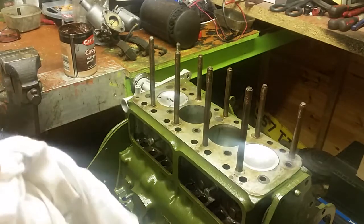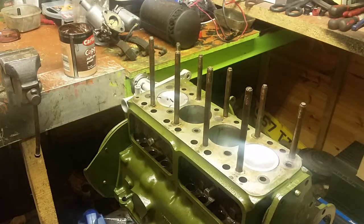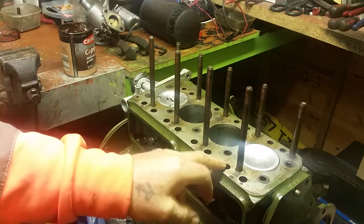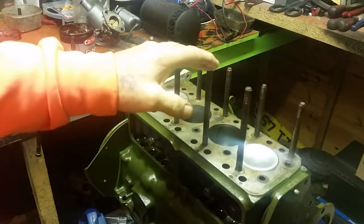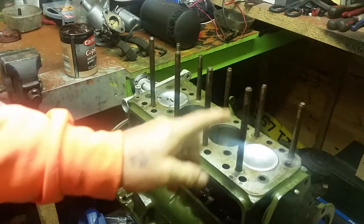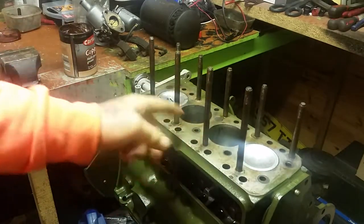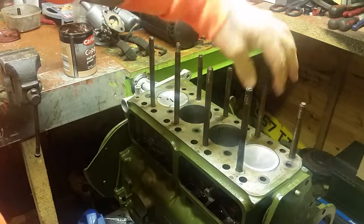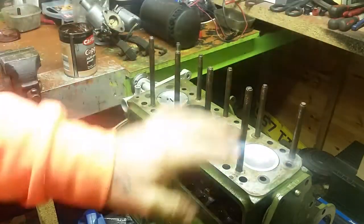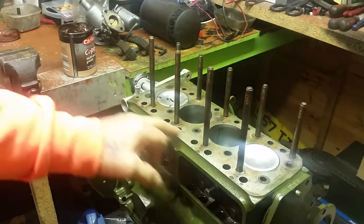That's that part done - not a big job. It's taken us actually six minutes to do that. Now your next job is the head gasket and the head. We've thread-locked the studs into place and tightened them down with a double nut so they're nice and tight. I've already given them a coat of copper grease, just to make sure they don't get stuck in the head again - that'll keep it nice and free when you take the head off. Make sure your surfaces are all nice and clean and flat.